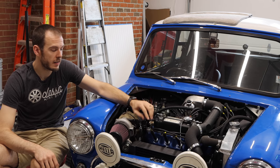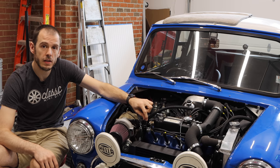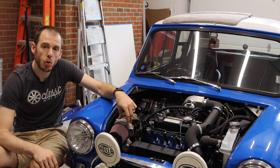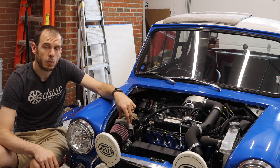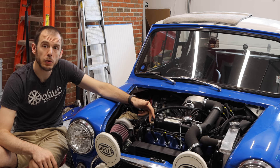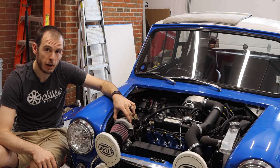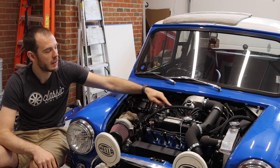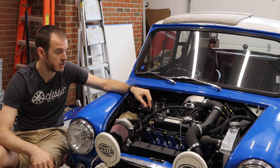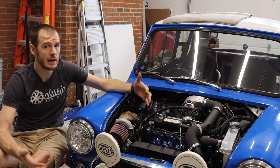Now, in addition to the hydraulic lines, I also needed to do some different things with the coolant lines. I have one right here and one down here. What I'm doing is piping the turbo into the coolant system. This is a water-cooled turbo, so it does have two ports, one for inlet, one for outlet, and that is taking coolant off the top of the head here, so coolant passing through the head. This is an 8AN fitting. It goes down underneath into the turbo housing, into the hot side of the turbo, and then out this top side and down into the heater, and then through the heater and back into the engine, full circulation. This is something that you can add to these GT17s. Depending on the turbo you have, you may not have a water-cooled system.